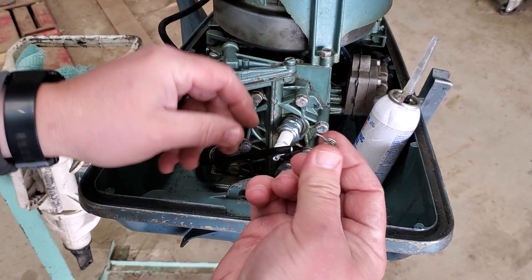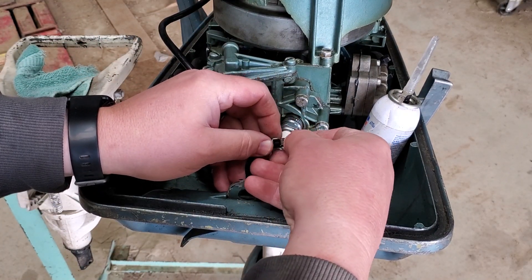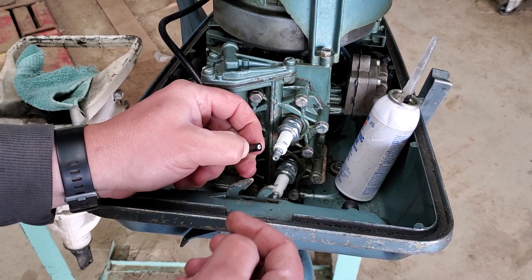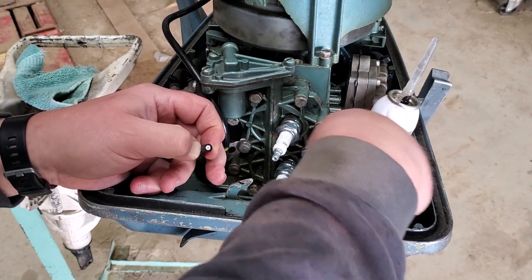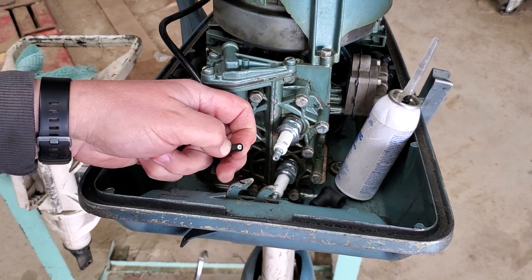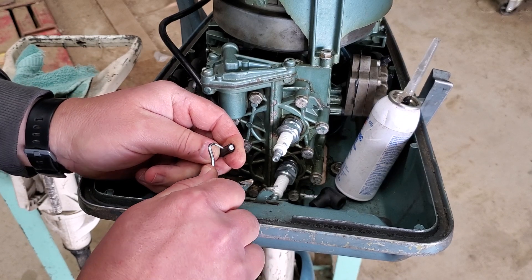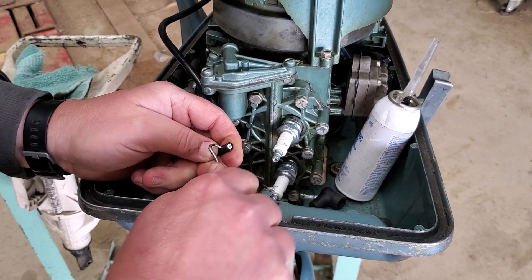First take this spring and set it against the wire and see where that spike is, then mark it or hold your thumbnail there. Take a pick — I've got a hooked one here, a straight one's probably better — and poke through the insulation to get it started and make sure we're into that copper core.